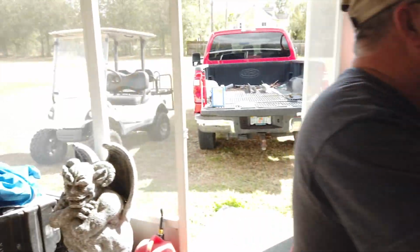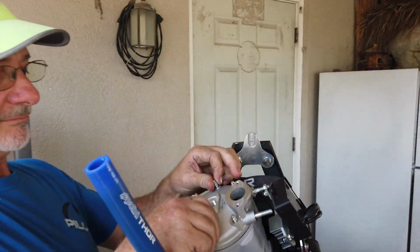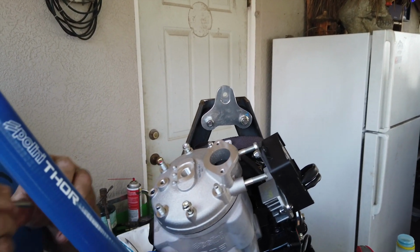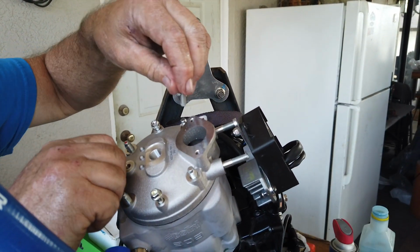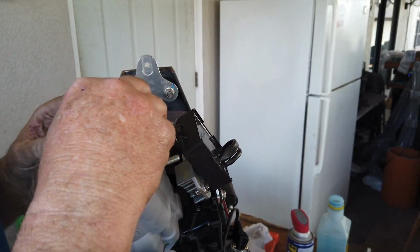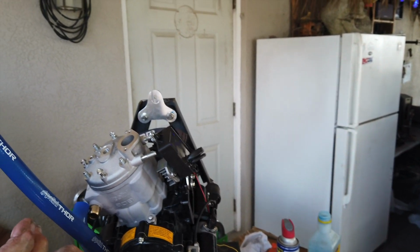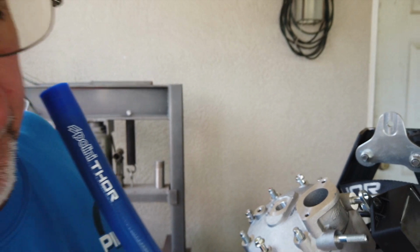It's marked with an up side and a part that points toward the exhaust manifold. After that, you want to put in your 6mm Allen bolts. You want to run those all the way in, but only finger tight. We put those in before the larger ones so that the gasket lines up, but don't torque those down yet. Don't forget to put the bolt back inside of the thermostat housing portion of the head and snug it down.